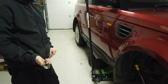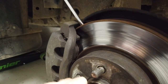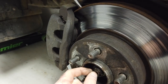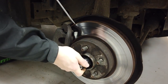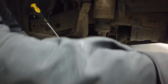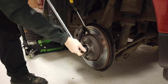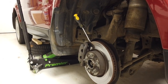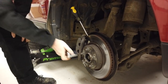It's a 32 millimetre socket you're going to need for the hub nut. Have a quick look at the thread - I don't think they're left-handed threads on these, but sometimes you have to run your finger around to check which way it undoes, because sometimes they are opposite-threaded. As I run my fingernail through it does seem to come out anti-clockwise, so try doing it the conventional way. That seems to be coming undone. We don't need that all the way off for now - leave it at least a couple of turns so we know we can do it, and leave it on while we take the brake components off.